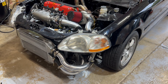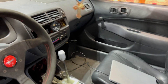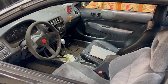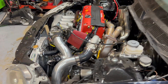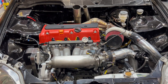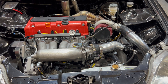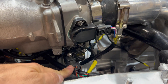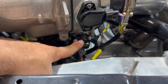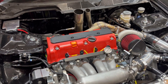Other than that I've just been driving it around and doing some base tuning — there's the wideband. I'm using a tuner named Ed off of HondaTech — I think it's Tuned by Ed — and he's been doing a great job, very patient. We've been sending each other at least one log back every day. Don't go with cheap idle air control valves from eBay because that was leaking as well — that was a big thing that messed me up.